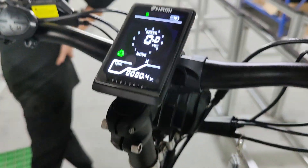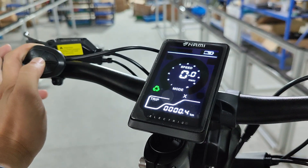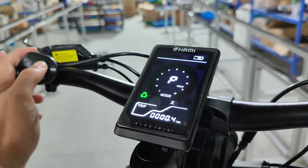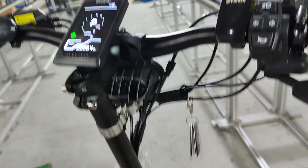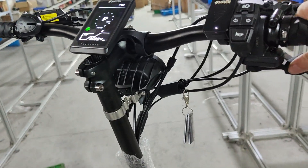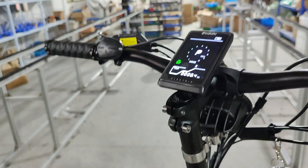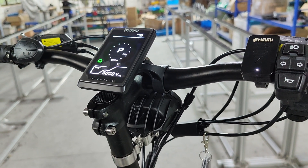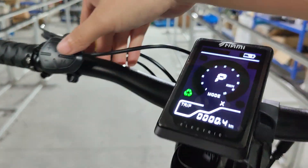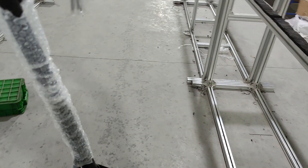Now I'm going to show you the power buttons. Let me access the speed limit mode. If I press the power button for a few seconds, there's a P flashing here, which means walking mode. At this stage, when you press the throttle the scooter will move, but the maximum speed is only about five or six kilometers per hour — it's used for walking into an area where there are a lot of people. You press the M button to exit the walking mode and the scooter goes to full power.